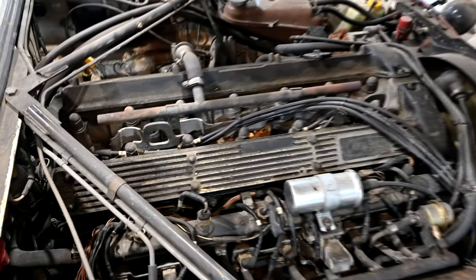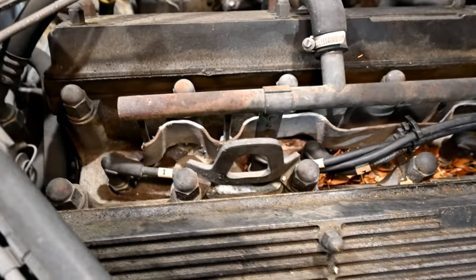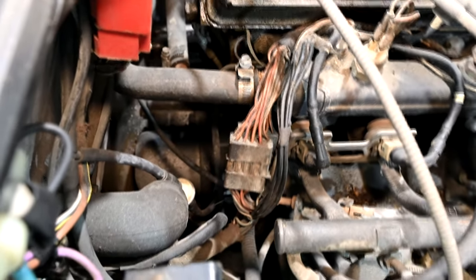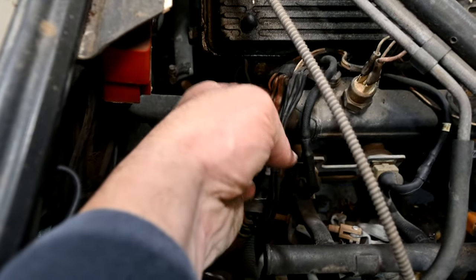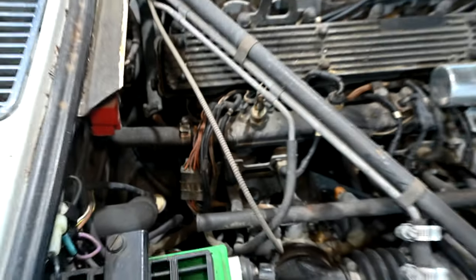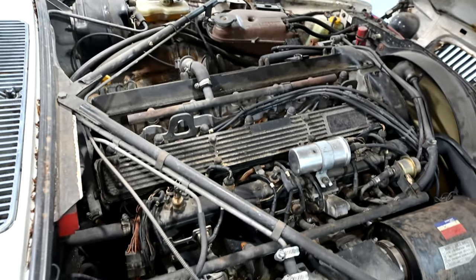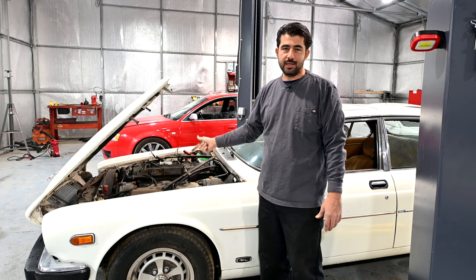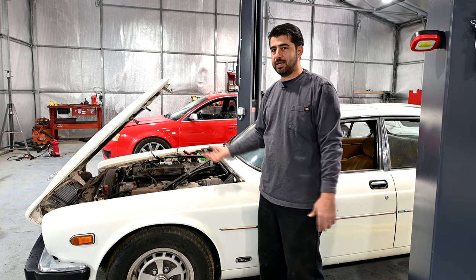As far as anything standing out on the engine, I left this car under a tree for about a week, and as you can see, rodents got in here and left behind some goodies. Also, some of these wires lost their protection — I don't know if the rodents chewed through them or they were missing from the get-go, but this one is laying on top of a coolant passage, so that's not going to be good. It's already getting hot, so we're going to turn the car off and take care of that and any other exposed wires before we sell this car. Before you start a car you just bought from an auction, make sure there's oil and coolant in the engine — I've obviously done this. I've also test-driven this car to make sure it doesn't overheat and there's nothing wrong with the transmission.